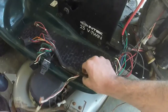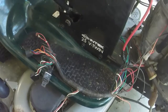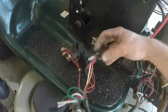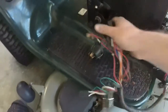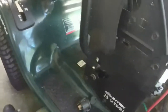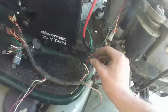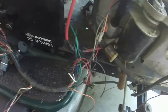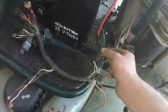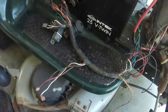I've got the wiring harness apart. I'm going to take off the plastic coverings and see what wire I can tap into that goes up to the magneto portion of the switch. We know this wire right here will blow a fuse if you ground it out with the switch still on — that's an accessory wire. So I'm going to take the sheathing off and find a proper ground wire to run up to the magneto.